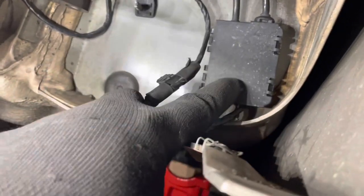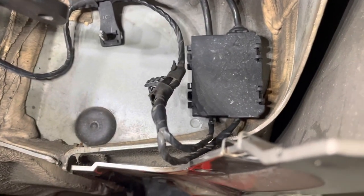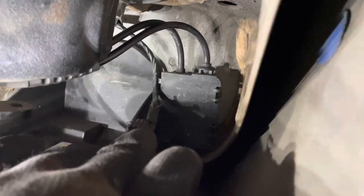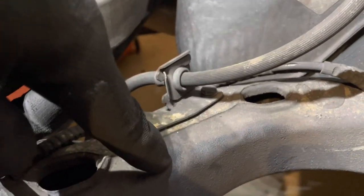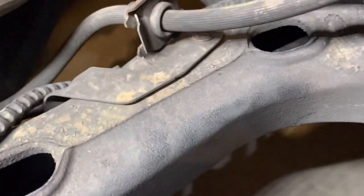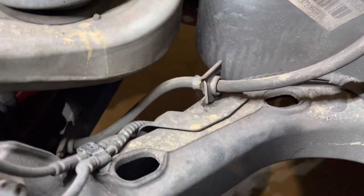The cable or the connectors go back inside the little box and do that up. This little tab here needs to go back on over the little captive thread sticking out there. Then we can put this back in. And I'll put the 10mm plastic nut at the top, the one underneath, and clip the electrical line back onto the edge of that plastic bracket. Now I've mounted the bracket here back onto the trailing arm, so there's the longer 10mm bolt in under there, another one down in behind at the back there, and those two are in, and then the electrical lines here back into their clip, so all of that is back in place.